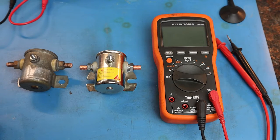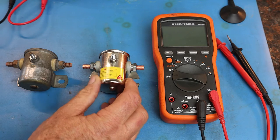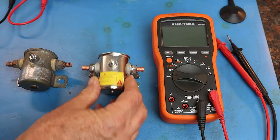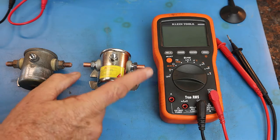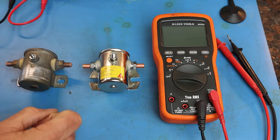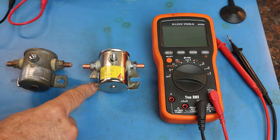Then we're going to tear the bad solenoid apart and try to determine why the solenoid failed. The first question we have to ask ourselves is, what is a solenoid? A solenoid is an electrically controlled switch. Just like a switch in your house — you turn the switch on, current can flow through the circuit and turn on your lights. A solenoid does the exact same thing, but with a little bit of difference. The solenoid consists of four terminals: two large terminals where current can flow through, a small terminal, and the casing of the solenoid acts as the fourth terminal, which is your ground.